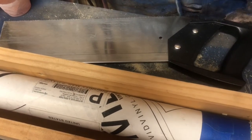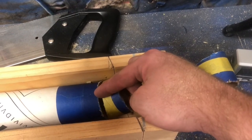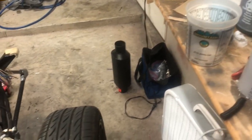And now I can't do it and hold the camera and all that. But when I hold that up there, just like that, and I use the digital angle finder, that angle right there is 36 degrees, which is exactly what the catalytic converter's at. So that's what I need. I now have to find a way to get this onto that because that ain't gonna fit in here.